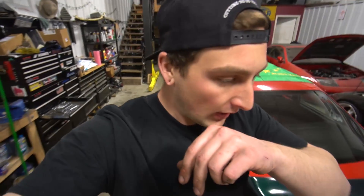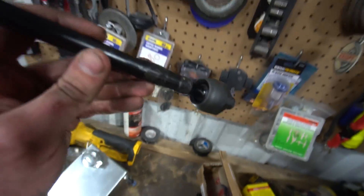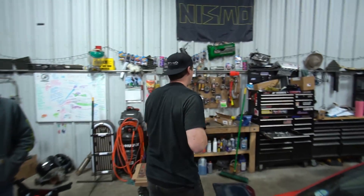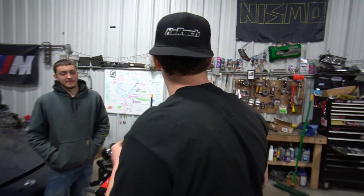Proactively ordered rack bushings and inner tie rods. I already replaced my tension rods — almost everything on the suspension is basically new. My rack bushings weren't as bad as I hoped, but my inner tie rod is smoked. You could move it by hand, which is really bad. You can hear it — there's play in there. And then a new one, I can't even rotate the damn thing. That's the same inner that we hit the wall with. Yeah, that makes sense.